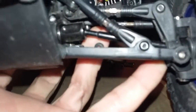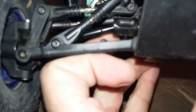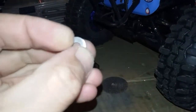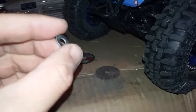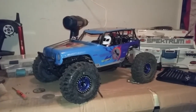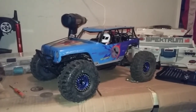It's definitely not a perfect fix, but it held up for what I threw at it in my backyard. I'm going to have to take this thing out tomorrow somewhere and put it through its paces. I can't see it from here but I know the passenger side is lined up pretty good — this driver side is a pain in the butt. Thanks for watching everybody. It only took me an additional three hours to get that rigged up. I started out with a fat washer, had to drill out the center a little bigger, then file it down to roughly half the thickness. A little over eight minutes for you guys to watch, and three hours for me to accomplish. This is Jim from JCRC — hopefully a success story from the WL Toys 10428 with the Vaterra Twin Hammers front drivetrain. Click like and subscribe, you all have a good night!